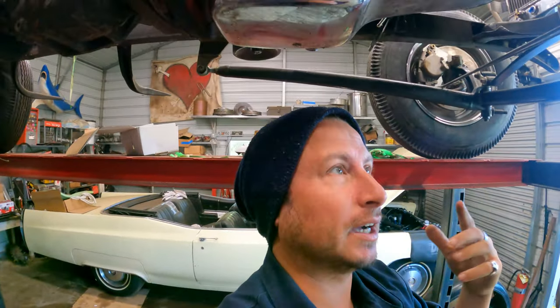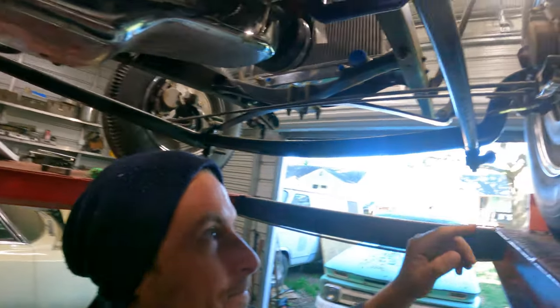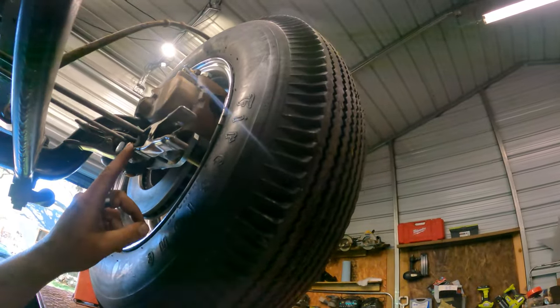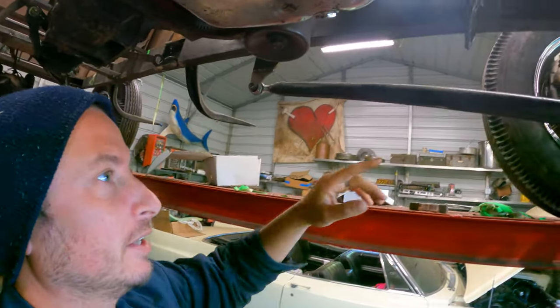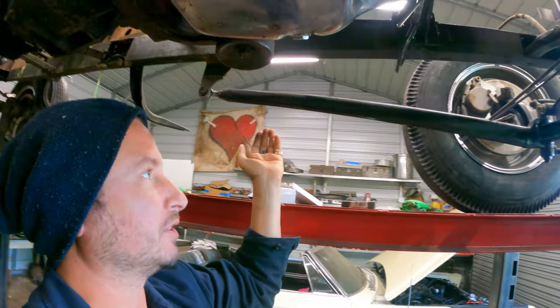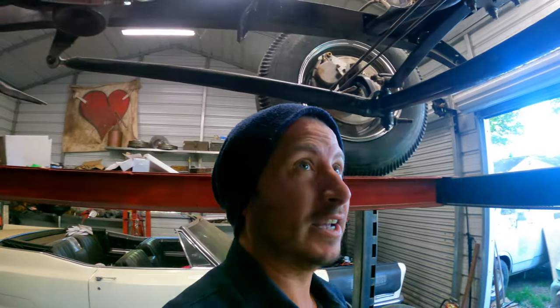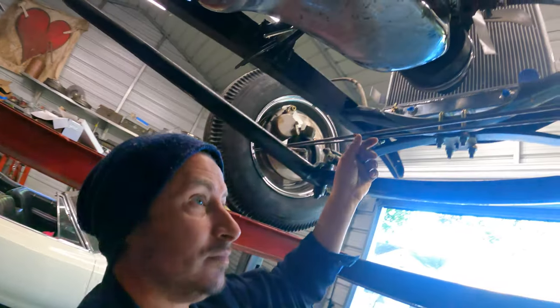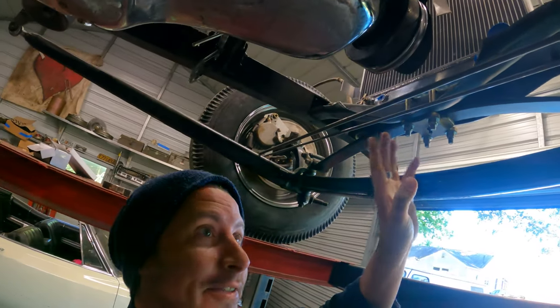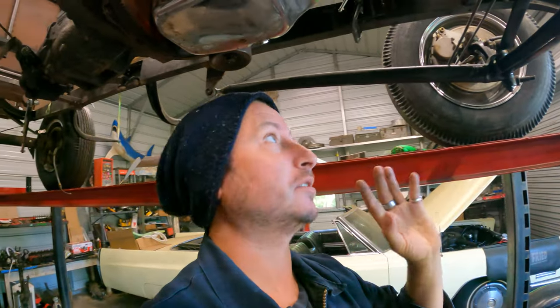Some people, you'll see when Iron Trap sets up their steering and bends the steering arms and all of that jazz, they cut this one off. That's because they're using a push-pull kind of box and they move the steering over to the driver's side. It works. The geometry is better with a cross steer. But speaking of cross steer geometry, the best geometry you're gonna get is if the drag link and the tie rod are parallel. Does it have to be that way? No, it's just the best, so that's where we're gonna start.